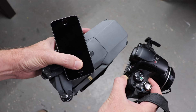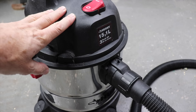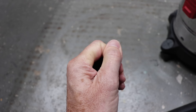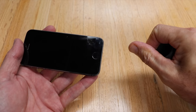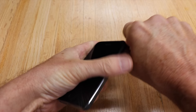It doesn't matter which device you have — first you want to remove as much water as you possibly can, and here's the best way to do that. Find yourself a vacuum cleaner; you're going to be sucking up a very small amount of water, so it doesn't matter what type it is — it doesn't need to be a shop vac. Take the vacuum hose and put your hand over the end so the hose won't hurt your device, and it allows you to adjust for maximum suction. First, power down your phone or remove the battery, and remove your SIM card. Turn on the vacuum and go to each opening on your phone, leaving it there for a good 15 seconds at each, then keep going for a good 3 minutes straight. This will get the majority of the water out.